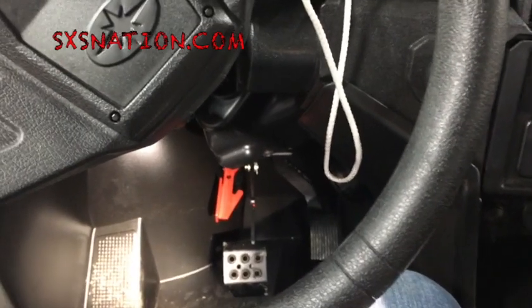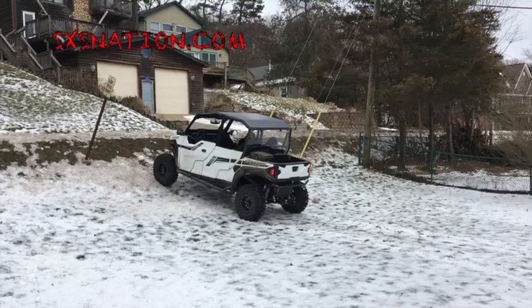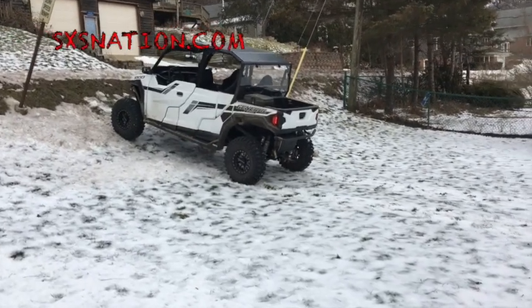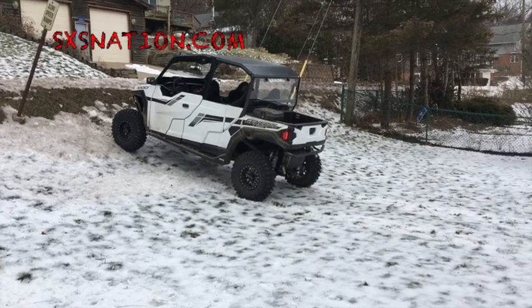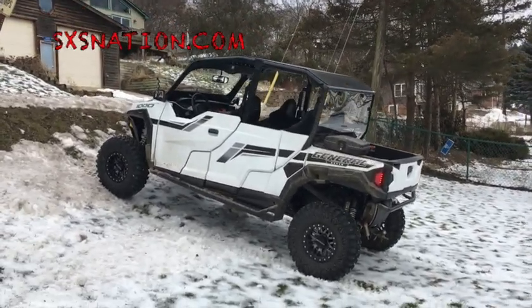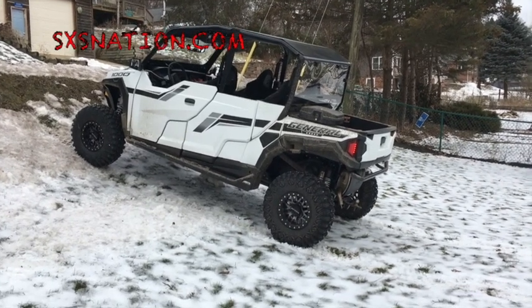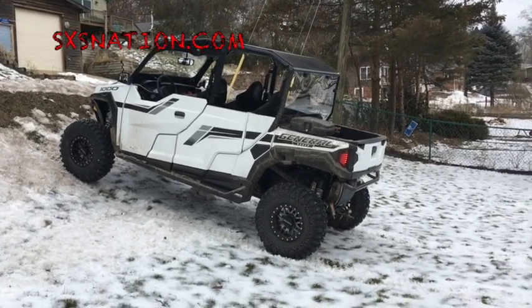Let's go do a quick test. I've got a pretty steep driveway — let's throw this thing up on the driveway and see if this parking brake holds. Pulling up into the berm here in my yard, it's a pretty decent-sized incline. I didn't pull all the way up — it's just too wet and muddy and I don't want to tear up the grass, but this thing's parked at a pretty decent incline. This brake's holding tight, I'm pretty impressed. You can adjust this thing for as much or as little tension as you want with the saddle bolt on the saddle bracket on the brake pedal — run that thing in or out if you chose to. For what this thing's intended to do, which is just take that pressure off the parking pawl, this is a winner.